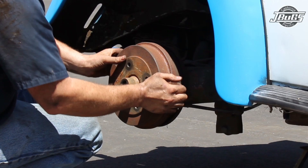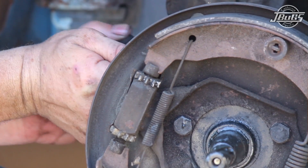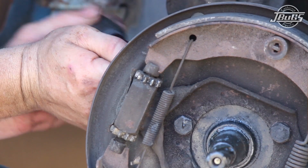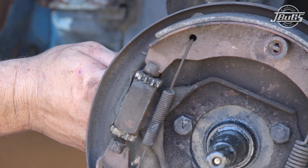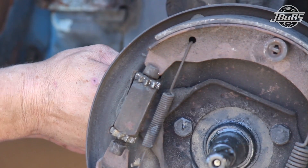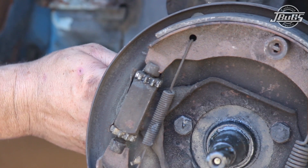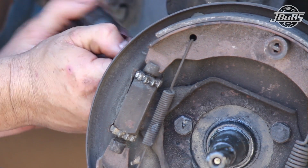Now we can slide the brake drum in place and adjust the brake shoes. To show you what's happening when we turn the shoe adjusters, we have the front drum off here. We use a flat head screwdriver to adjust the brake shoe adjusting nuts, accessed through the holes in the backing plate. When you turn the adjusting nut, the screw will move either in or out to push the brake shoe up or let it pull down to loosen or tighten the brake.